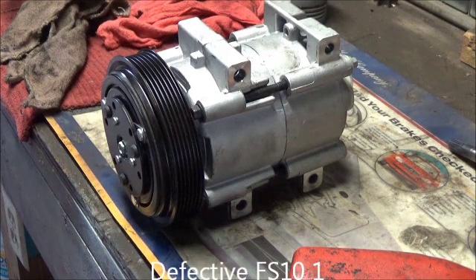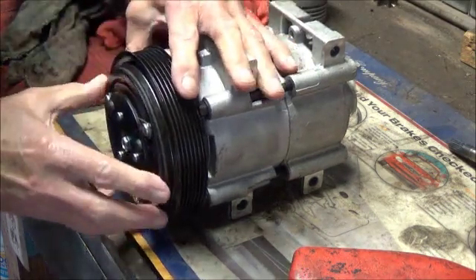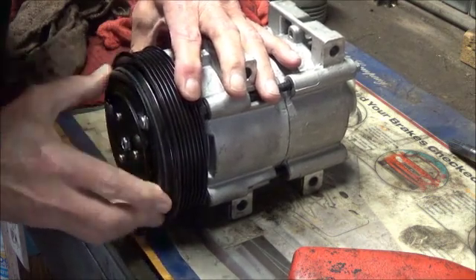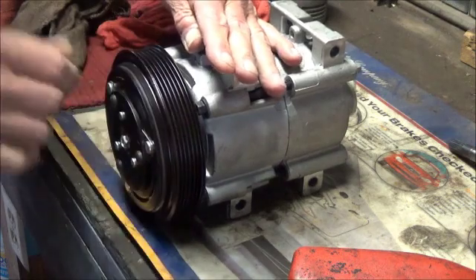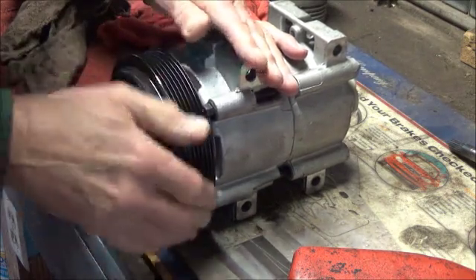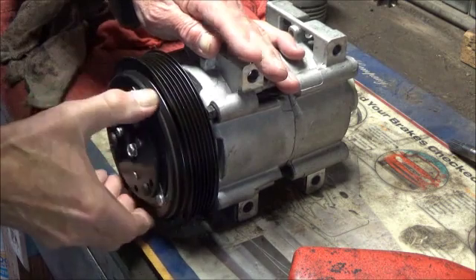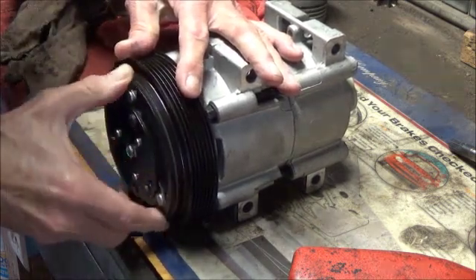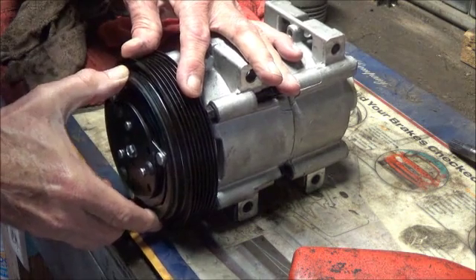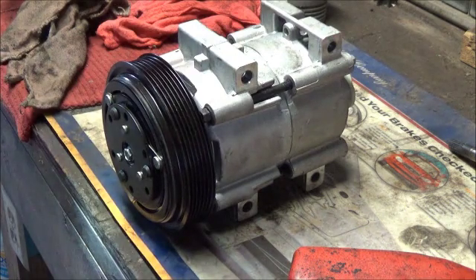Here's the first new compressor I got that was defective, and I'll show you why. Listen carefully. The clutch gets tight there — rubbing there, rubs there, rubs there. Now it gets extremely tight in one spot. So this isn't just a matter of the air gap. It gets very tight. There's something bent and we're going to find out what it is because I'm curious.